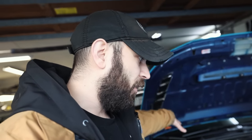Our heads are about 4 to 5 weeks out for the 07. Castings are on back order. So we just went with a set of IAG, I think it's their 500 series or 550 series, something. It's like their stage 1 head package. So GSC cams, valves, springs, retainers, whole kit and caboodle. But they're just on back order since our OEM ones that we pulled off of that 07 are scrap, unfortunately, and castings are on back order. So it's just the way things go right now.